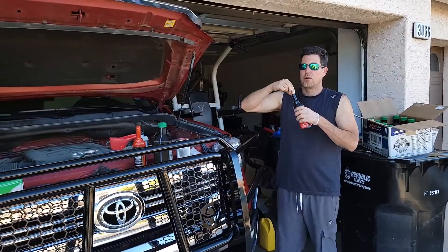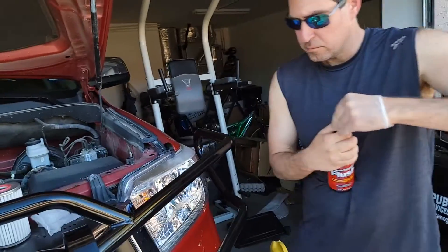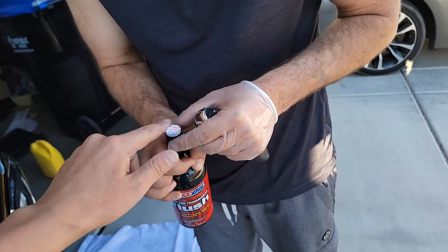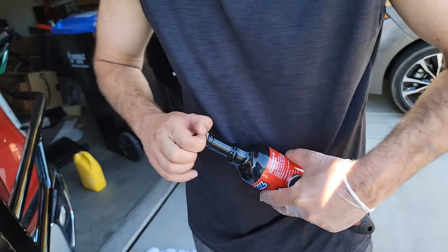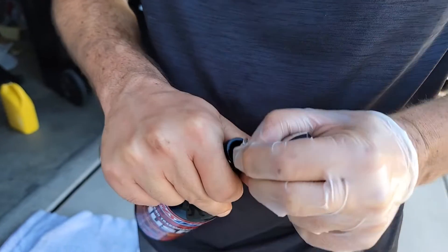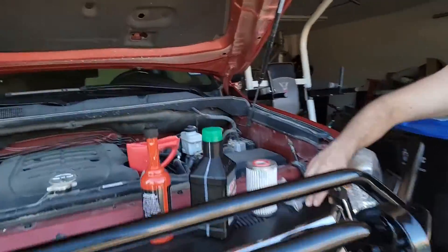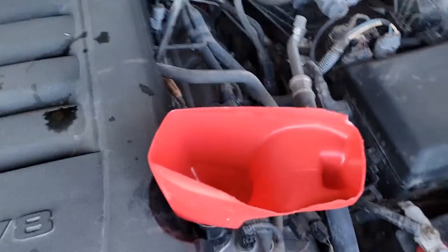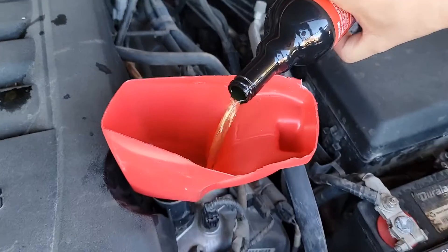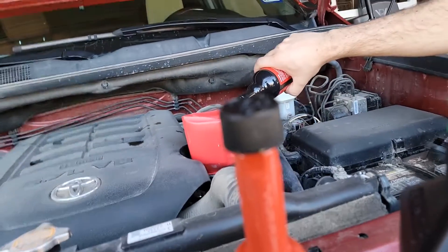That's going to go in the motor. Matt asked, don't we have to drain it first? Not at all. The flush is going to go right into the crankcase motor oil. You just push here, flip this, taco that little flap up, and pull sideways. And now we just go ahead and dump it in. This very thin detergent is going right into the crankcase motor oil.